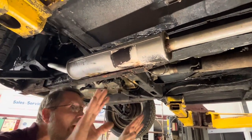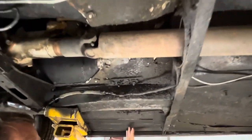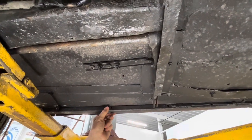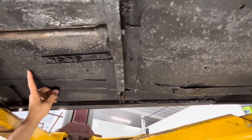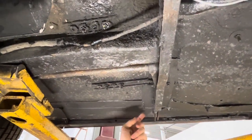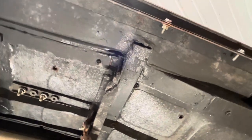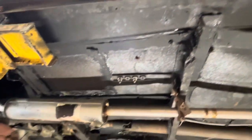Moving on further back, it looks like the rockers on both sides have been reworked — the whole edges of the floors — so it's all been rust repair, and it looks like they just did it with whatever they had laying around. This side here has a piece of one-by-one square tubing and then some flat plate, which is a lot heavier than the original stuff. It's just made to fit and work, not to look anything like original. On the other side it's got angle iron instead of square tubing, made kind of similar, but still not quite like it should be — though it's thick enough to provide strength, just isn't right.